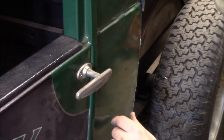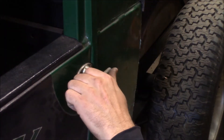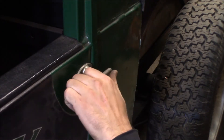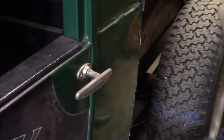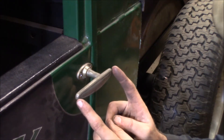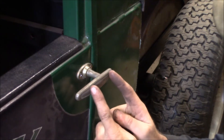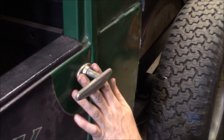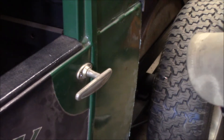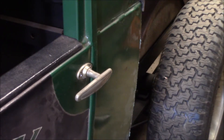All right, bam — look at that. The door handle is installed, just loosely on here, but you go click and it'll open the door, and this will ride just like here — like factory. Look, this handle is a little bit bigger than a '28-'29 pickup handle, which is more like a rectangle and a little bit shorter, but they pretty much all use the same escutcheon mount style here. So this will be good enough for what I'm doing — a little custom action here.